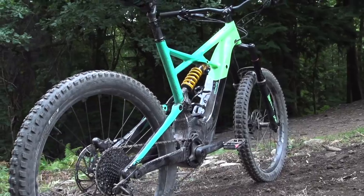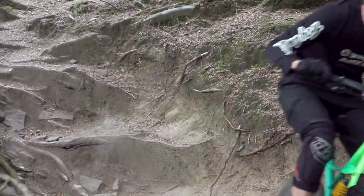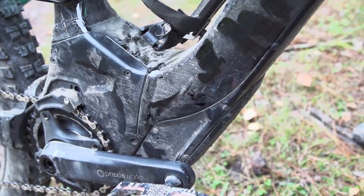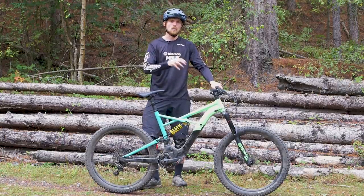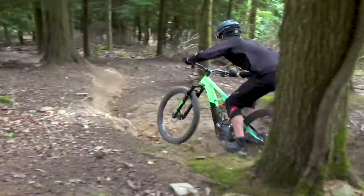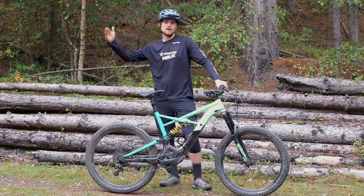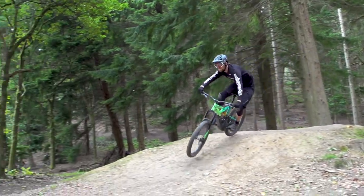This is the Specialized Turbo Kenevo, which I think is one of the most interesting e-bikes on the market today, because it's got an awful lot going for it but it's also quite flawed in some interesting ways. While most e-bikes use either a Bosch or a Shimano motor, Specialized developed a motor along with a German company called Brose. This motor is not seen in many other e-bikes. Unlike the Bosch motor it uses a normal sized chainring, which means that the suspension kinematics aren't quite as compromised. Also, the Brose motor disengages when you're above the 25 km/h speed limit, meaning there's noticeably less drag than with a Bosch motor.